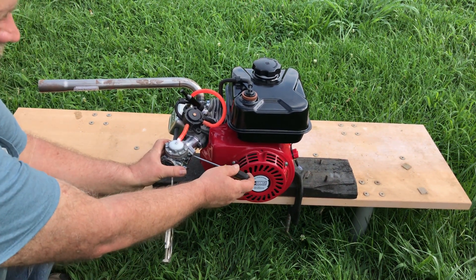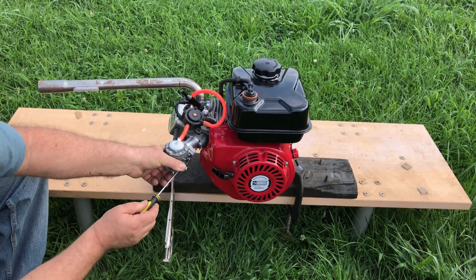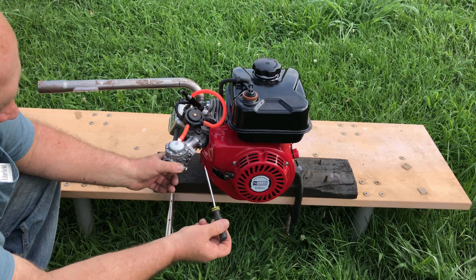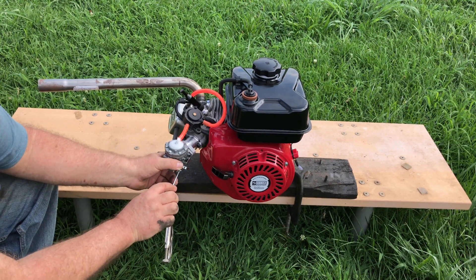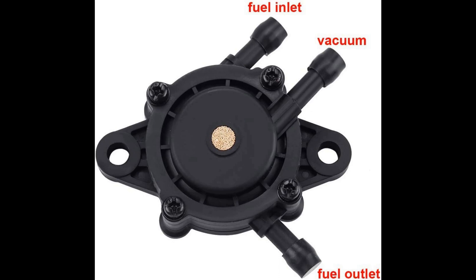I've got to turn this low speed screw in — I had it wound out about two and a half turns trying to get it to run earlier. Going to turn it back in a little bit, lower my idle speed now. Running it up some more — where I ended up, it would have been right at one and a quarter turns out. Oh yeah, that's much better! So again, this little diagram — you can pause this if you want to run those little cheap pumps; they're pretty good. That's all I got for today, thanks for hanging out with me, we'll see you next time.